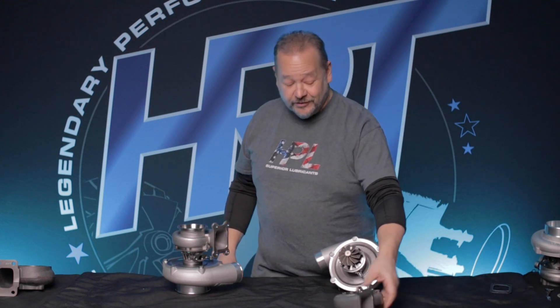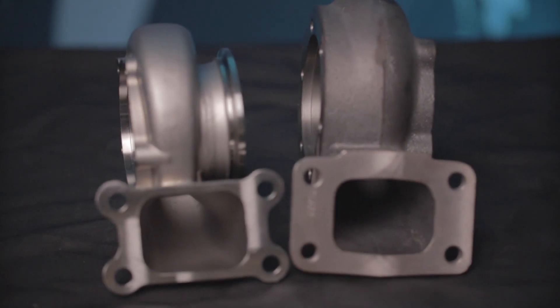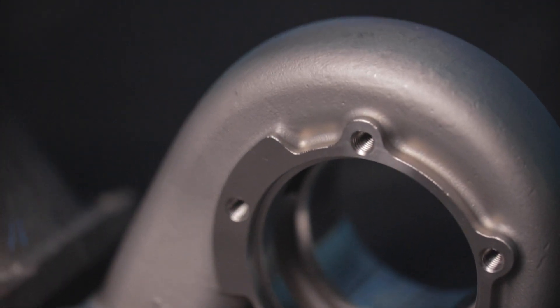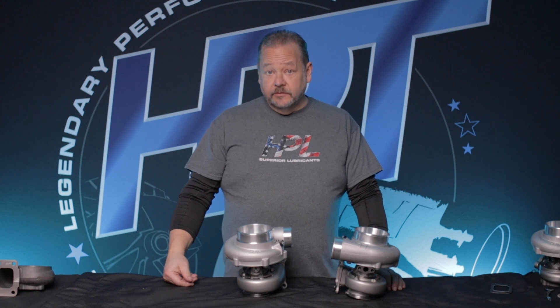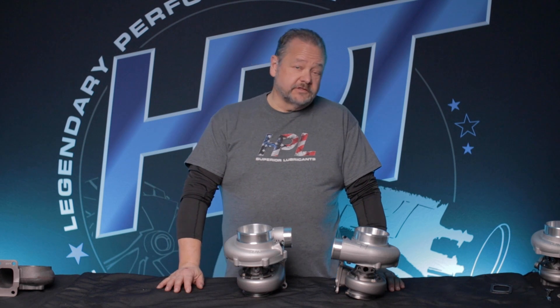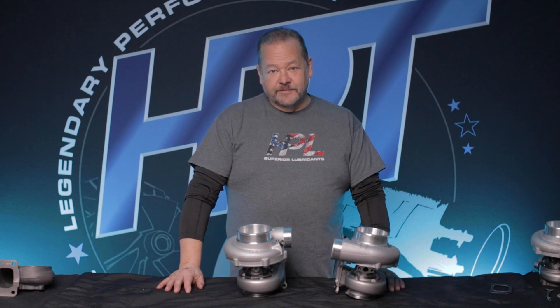I'm really feeling like this — it only weighs 3.8 pounds. Here are a couple of F2 turbochargers. The most popular 64 and 66 units out there these days have a stainless steel V-band in and V-band out turbine housing. It seems like over the years the T3 turbine housing has been ignored, but not anymore.